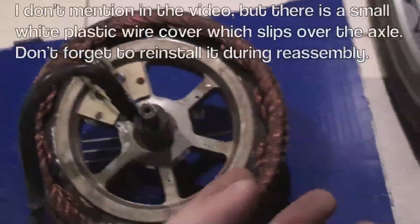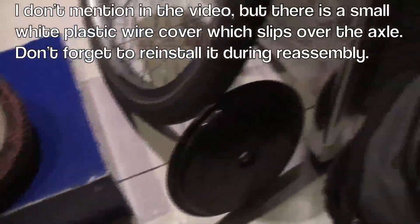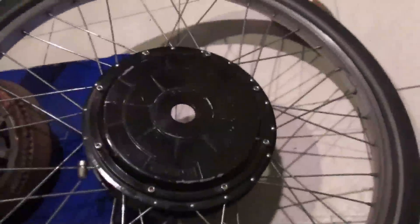What you do is loosen on the side of the motor that has the wire. There are some hex nut allen wrench type screws — I think there's 8 of those you have to take off. Then you flip the motor upside down so that the wiring is facing downward, get the wheel balanced across something like two pop cases, get the gear puller on there, and you push the motor out. It kind of makes a popping noise.